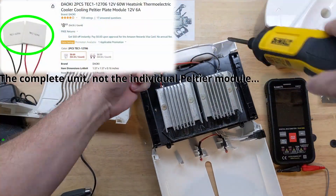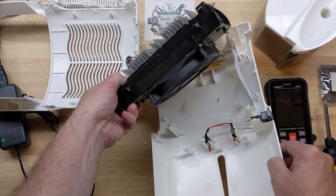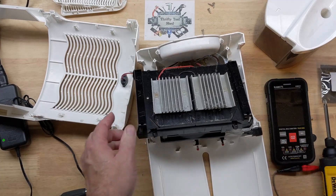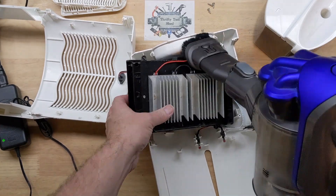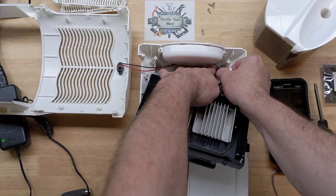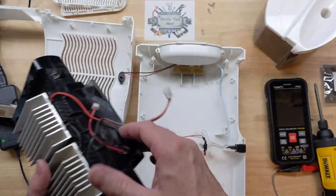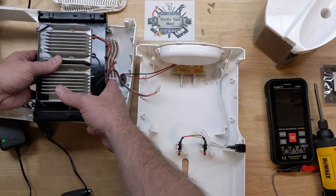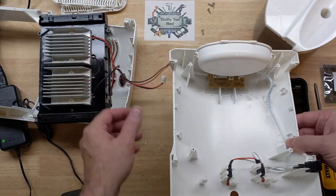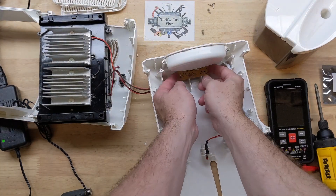Now I'm going to take the Peltier device and the fan off. I don't really have to do it for this repair but I want you to see it. I'll vacuum off the heat sinks and then take it outside and blow it off with my blower. I'll also show you this board and just how simple it is — you have nothing but a fan and heat sinks with your Peltier device that does hot on one side and cold on the other. It naturally condenses and drips off the heat sinks, collecting in the bucket. This board just unplugs — just two Phillips screws.